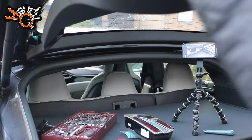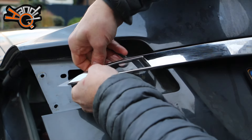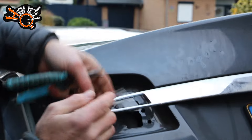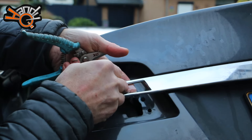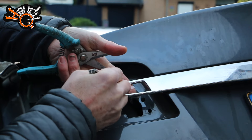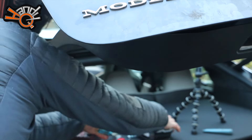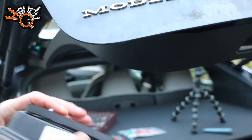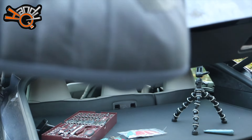Let's see if the new tape fits. It needs to be trimmed here because it's overlapping a little bit — I'll use a knife. Two-sided tape can be a bit gummy but it's working. There's a little bit of extra trimmed off. Now to put the new light in — it has a plug that goes in here, and there's a push button on the connector to release it, which is on the inside of the car. Here we go, moment of truth — new light going back in.